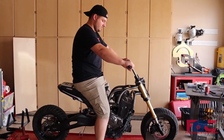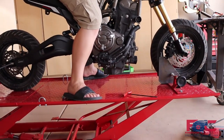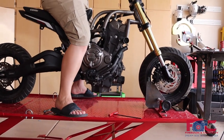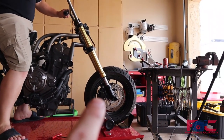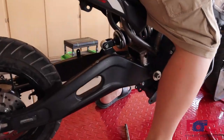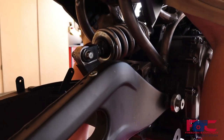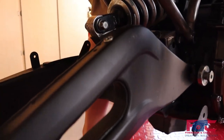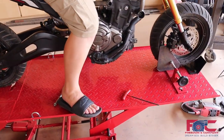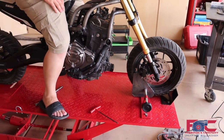You can see just for scale it's still a tiny Grom-looking bike. You can see our ground clearance — if Paul bounces a little bit, we still have at least four inches of ground clearance, so that's not a problem. You can see the front is getting a little close, so stiffer shocks there as we said. The rear is just the stock FZ07 spring and dampener, and that's actually working really well. We have it on the lowest preload setting and I think we're just going to stick with that. If we want something different later, we can always get an adjustable spring for the stock FZ07 swingarm.